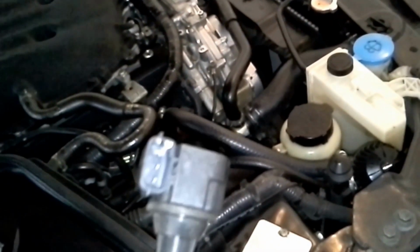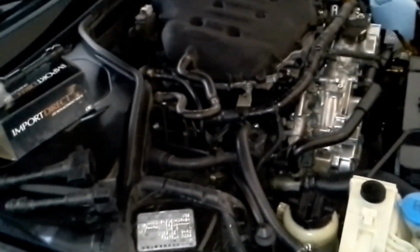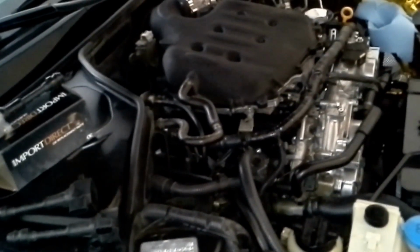So it gave me a misfire. And since my car is tuned, when I got the misfire, you could smell gas really bad because of the test pipes. So you could definitely know, the car starts to idle like it's basically a diesel. It sounds bad. You know immediately.